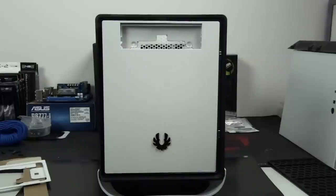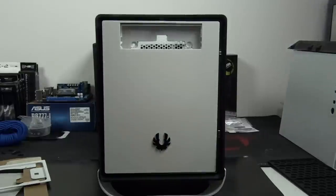The first thing I wanted to do was add more ventilation to the front panel. The black version and white version of the BitFenix Prodigy actually have different front panels — the black version has ventilation right across the front panel, while the white version only has ventilation around the outside. Because I'm installing a 240mm radiator directly behind this front panel, that is definitely not enough ventilation in my opinion. I wanted direct ventilation to the radiator so the air goes straight through with minimal turbulence.